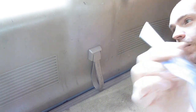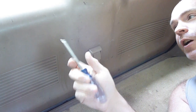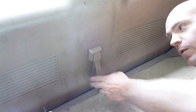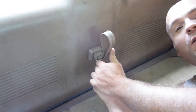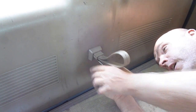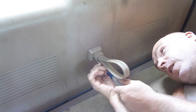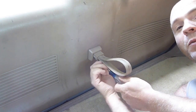As you can see, I'm laying here on the back floor looking at this handle here — we're in the back of the car. In the back liftgate, when you pull on the handle, nothing is going on, so there's something wrong in here. There should be two Phillips screws under here, but in this case there's only one because people can't be bothered to actually put screws back where they belong — one of my biggest pet peeves.